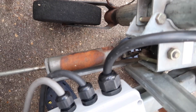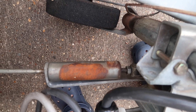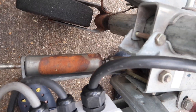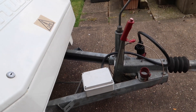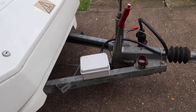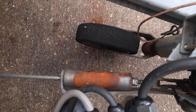What you can see there is the energy store, and that is where it's different to car brakes. A car handbrake works directly on the brakes on the wheels, and when you apply it, it will not move forwards or backwards. With a caravan with a properly set up braking system, you can pull the handbrake on two clicks — you won't be able to pull it forward, but you can push it backwards. That's because the shoe mechanism, when it's pressing against the drum and you rotate the wheel backwards, the shoe mechanism will actually turn backwards.